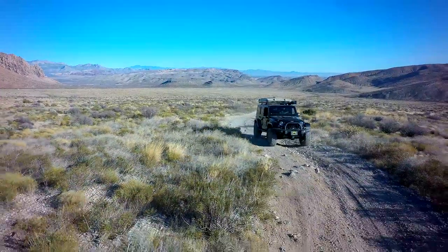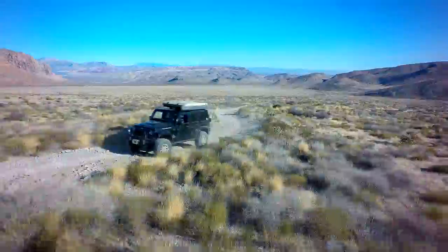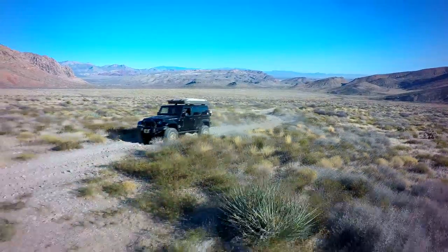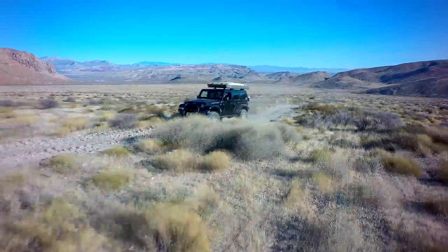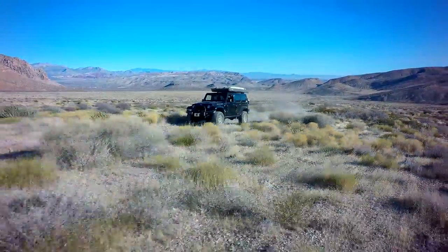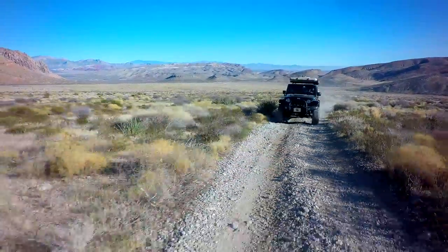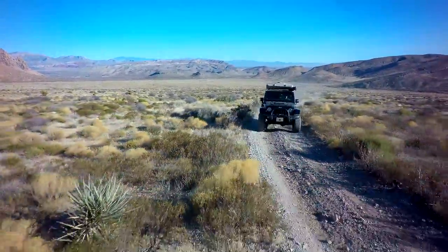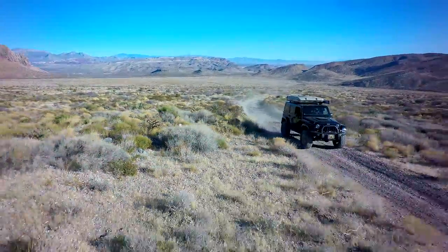This L96 has a lot of torque — it's not as powerful as the LS3 on the top end. You can do some tuning on these 6 liters and get 350 to 375 horsepower easily out of them. A lot of guys ask me how docile the LS3 is, and I can only say it's about as docile as a stock engine. It idles really low and really solid — there is no rump rump rump, no hydrocarbons blowing out the tailpipe. It's just a really docile engine.